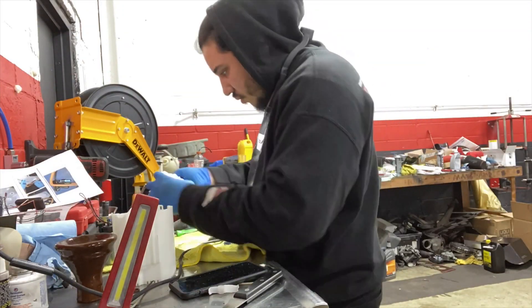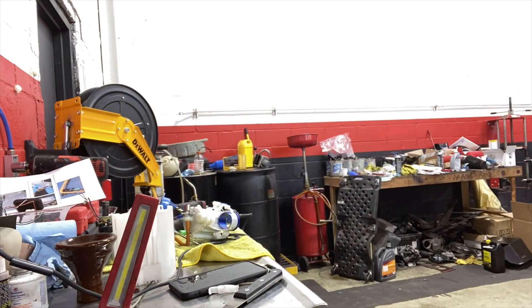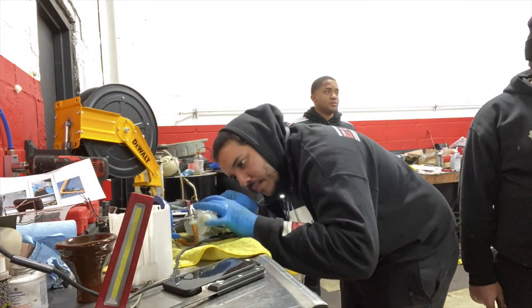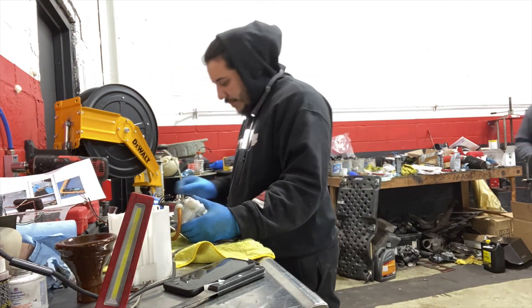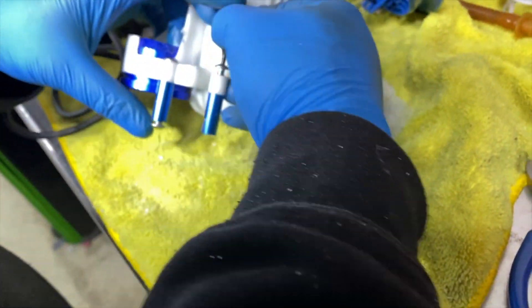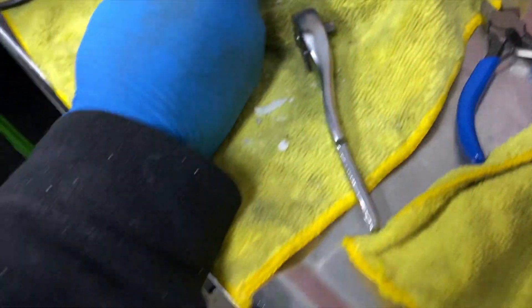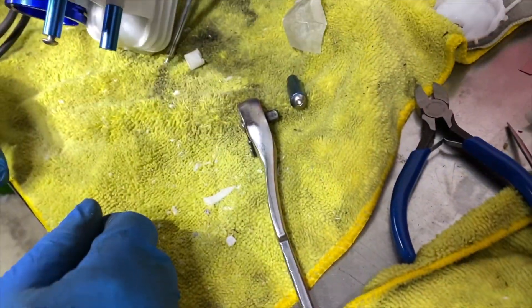So now you're just assembling everything? Yeah. Felipe was having an issue with number 21 — when it came to cutting down, it says to cut up to here. But when you install the kit, it actually has the spacers. The spacers — they don't tell you to cut this piece off, which is weird. So it sits up high, but when you put the spacer in, the bolt can't reach from the top.